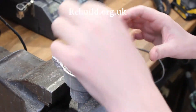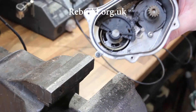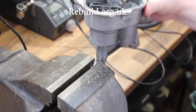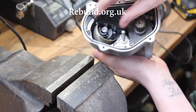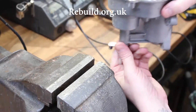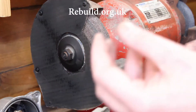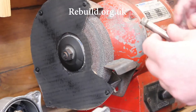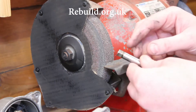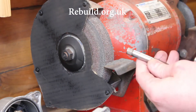Effectively what I've done is just weakened it enough so it can be broken out. There we go. Now you've removed the worn-out half gear from the BMW shaft — we just need to remove this lip and the lip around the top, but it's very important that we don't touch the splines; they need to remain how they are.